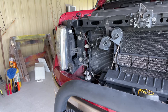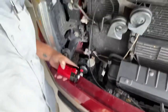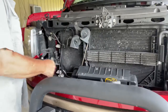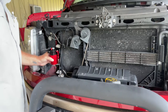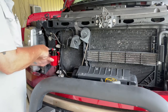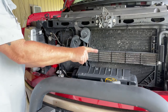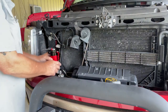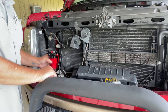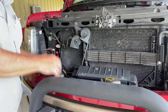I'm thinking about taking that piece of 12-gauge flat stock — there's a bolt down there under the horn, see that bolt? I'm going to bend it at 90 degrees and put the can right here so I can still unscrew it and get it out, but at the same time the hoses are going to go in here. I might take them through here and do the same thing on the other side. I could mount them underneath but then I'd have to get on my back to empty them, and I don't want to do that.